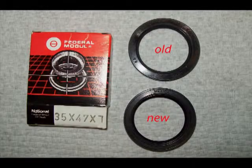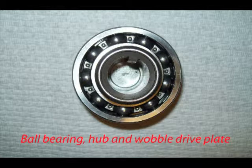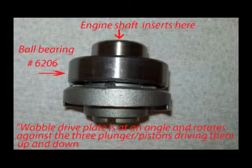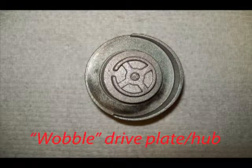Unless you have access to a press, please don't undertake this. This pump uses a double row ball bearing. The bearing number can be cross-referenced and should be available at any auto parts store. This shows the bearing, the wobble plate, and the bearing part number. Do not use your press on the center of this wobble plate hub — it's far too fragile. You will have to make an adapter that's cut at an angle out of wood, metal, or maybe even PVC pipe in order to press this wobble plate back into the bearing.